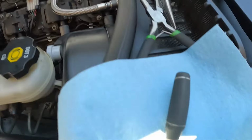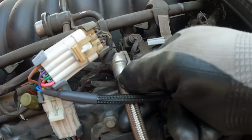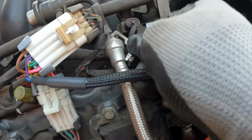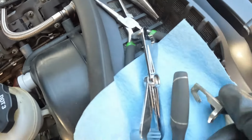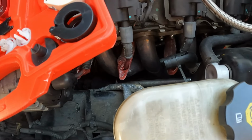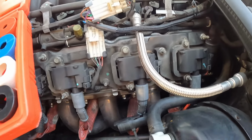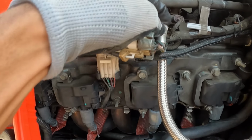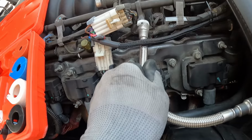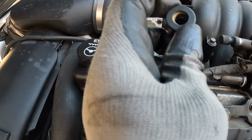And then you get to go to this little silver line right here. There's a little metal piece that is a little safety thing. You just release that like that, take it out, and then you're gonna have to get one of these little fuel line removal clip thingy things. So there's 4 tabs in this little line. You're not gonna get them all on one shot unless you're lucky. I had to take the little tool out and push it back in a different way.